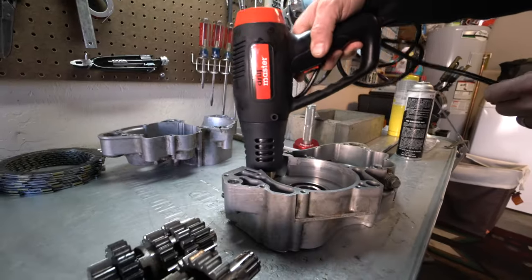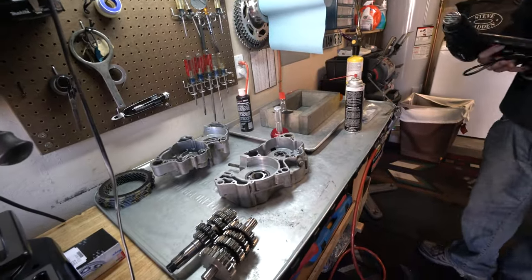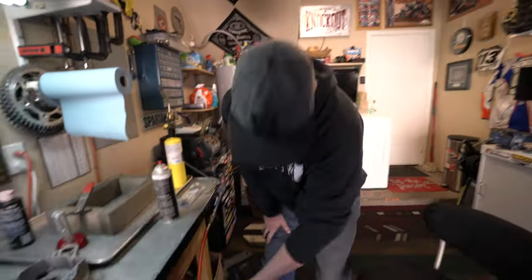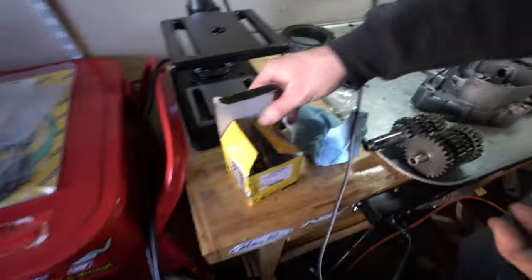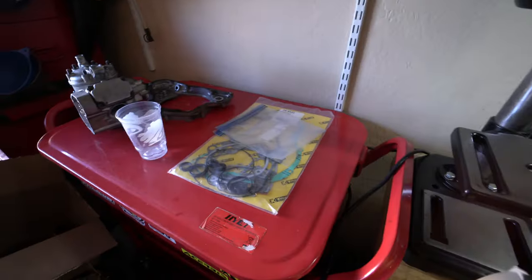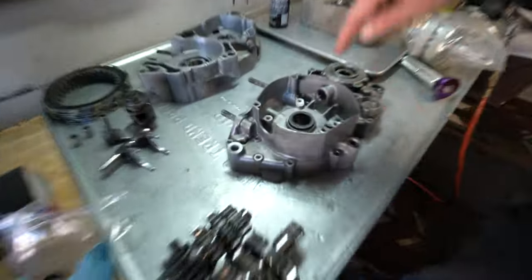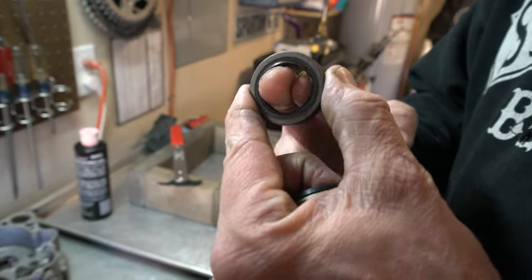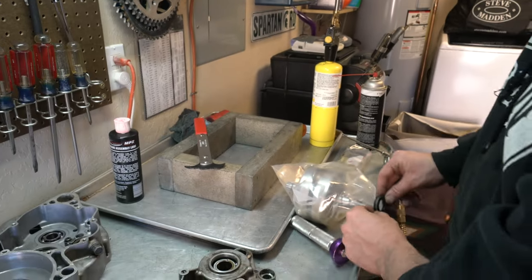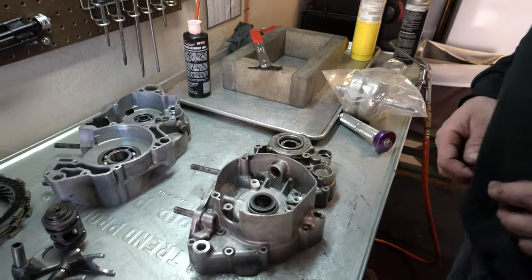She's hot, so we're going to let that cool down to room temperature and go from there. This seal came in that bearing kit — we're going to use those instead of the ones that were in the other kit. If you recall from our picture, this was installed like so, and you can also see the lip faces outward. When the crankshaft pulls through, it'll push against that and spread correctly. So we want to install that one in there like so. To do that I'm going to need more gloves and some grease.